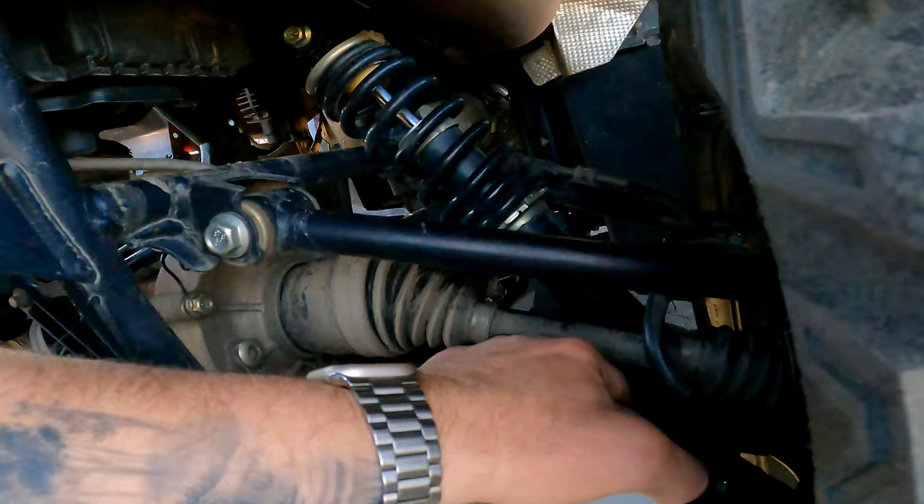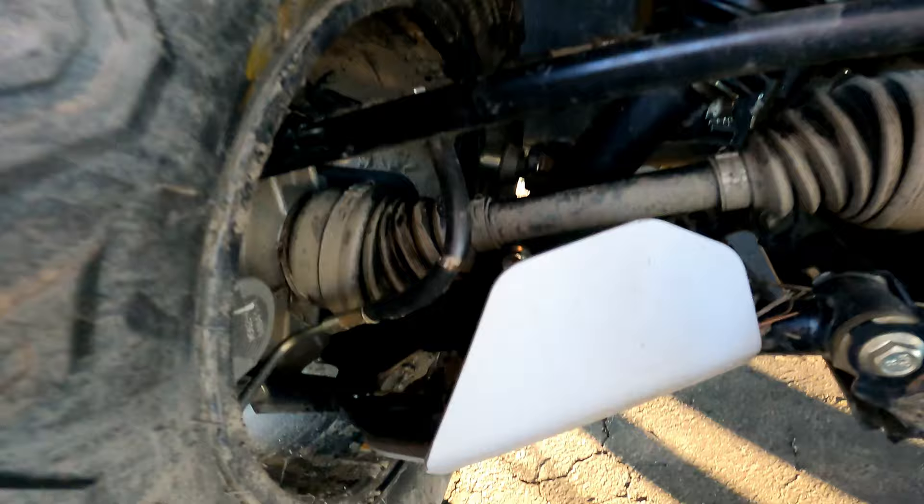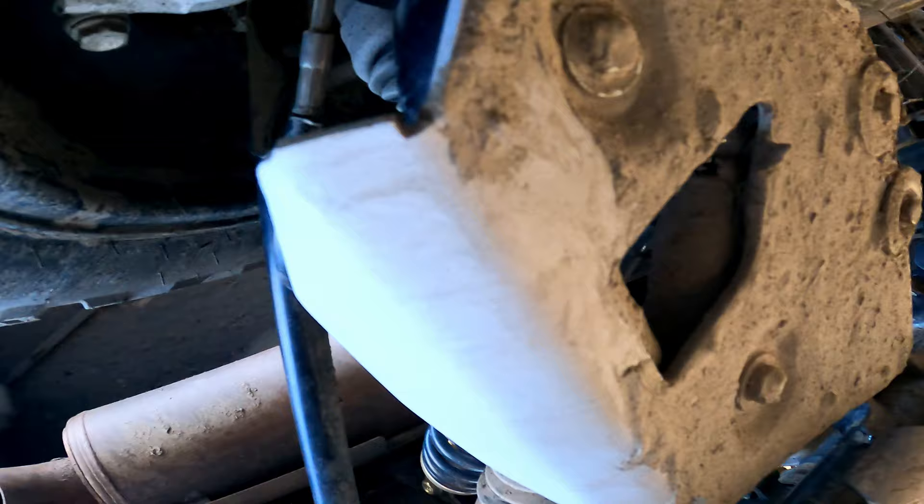The other bolt on the front side of this plate actually screws into a hole that's already recessed and threaded inside the rear lower control arm. My suggestion is clean that out with an awl or a very tiny screwdriver — dirt is packed up in there. I found out the hard way: I was running one home, ended up tightening it a little too hard and snapped that bolt. It's still holding — there are two on this side holding pretty good — and so far I haven't had any issues, no rattle.